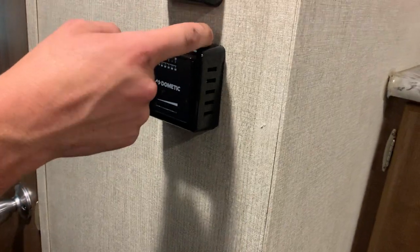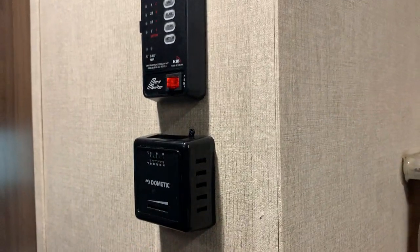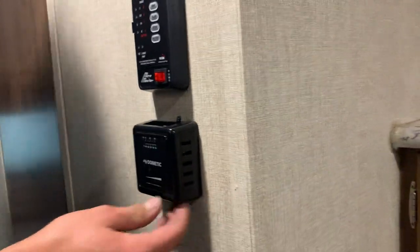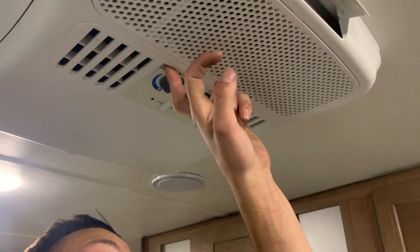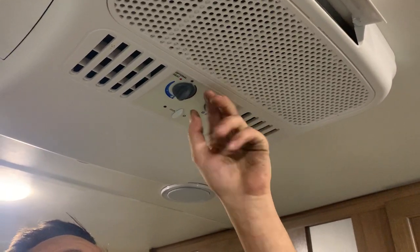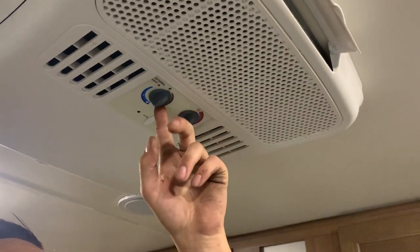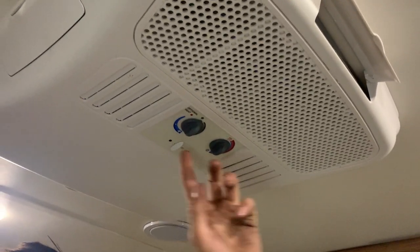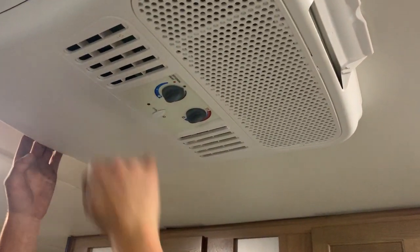You've got your thermostat for your furnace on the wall. To turn your furnace on you do just have to turn that switch over, and then you've got a little dial on the bottom for how hot you want it — sliding it all the way to the right is the hottest setting. Up on the ceiling you've got your controls for your AC. It says it has a heat pump, but there is no heat pump installed in these units — it's just an air conditioner, or you can run it just as a fan. If you have it on the blue, the AC is on; if you have it on the gray, it's just the fan. You can run it with the louvers closed, in which case it'll move all its air through the flaps on either side, or you can open those flaps up and they'll dump all the air straight down.